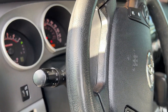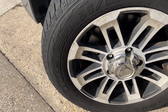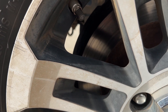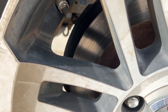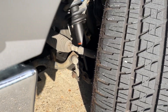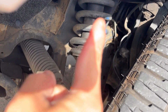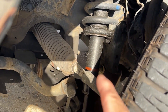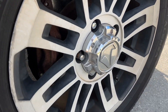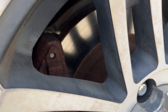This vehicle has roughly 200,000 miles on it. I want to turn the wheels so you'll have a better angle, but you can see the normal wear going on right there, and the pads are worn out. Here are the shocks — you can see the residue where it's dry right there, and right there it's wet. Here's the other side, passenger side — same thing, very rusted. And there is the rotor.